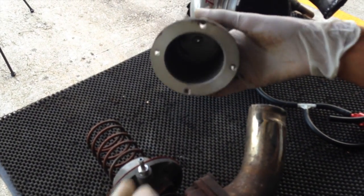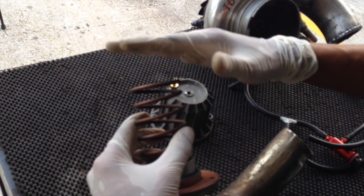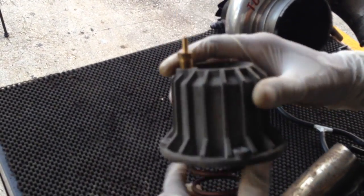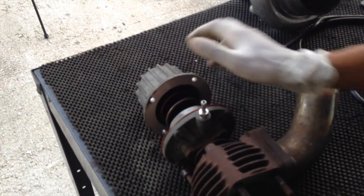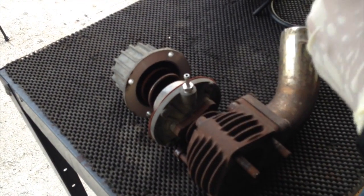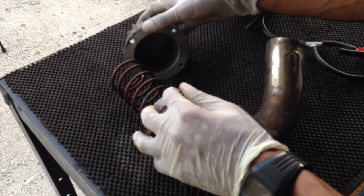So what I've done in many cases when I don't want to use a manual boost controller, what I'll do is pack this up with some shims roughly the same size. What's important is it has to be big enough to cover this. As you increase the shim size here, this would be a lot harder to close, and then you would just run the bolts down, increasing the resistance and making this harder to open — not only giving you a little bit more boost but also a sharper boost curve.